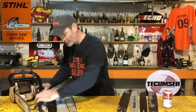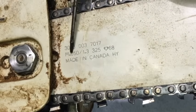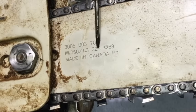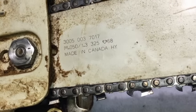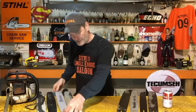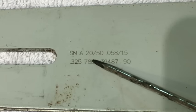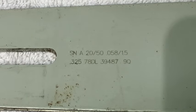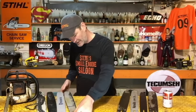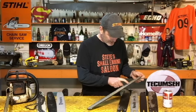Let's look at these guide bars. Stihl — I know some of you pronounce it 'still,' that's fine — and Husqvarna are very clear on their guide bars. Look at my little MS-230 right here. Could this be more clear? It says right on there 058 — that's your gauge — 325, that's your pitch, and clearly it says 68 drivers long. That has all three numbers you need to order that chain online. Here's a Husqvarna bar: 325, 78 DL — DL stands for driver links — and up there it says 058. Here's an Oregon bar: same thing, 325 pitch, 78 drive links long, and 058 up there.